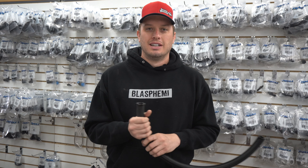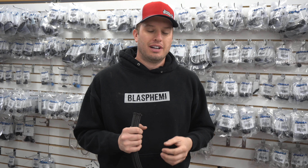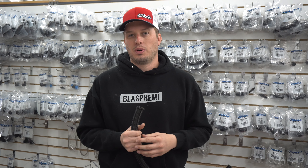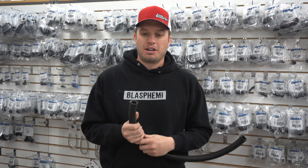It just so happens that by the time all that stuff makes its way in, you're ready to dyno the car. So you go to the dyno, the fuel pump isn't performing, somebody calls upset saying they're out of fuel when they shouldn't be. I say take the pre-filter apart, they take the pre-filter apart — or the post filter — and sure enough it's clogged with stuff from the fuel cell, fuel lines, fittings, and assembly.